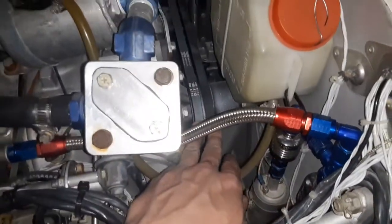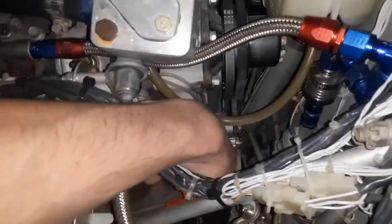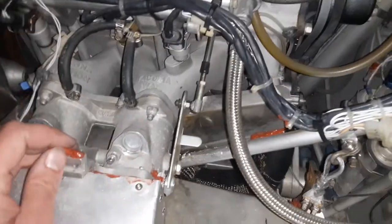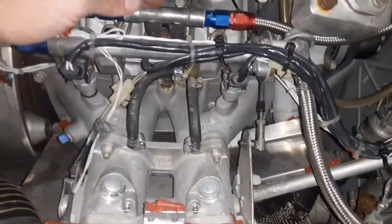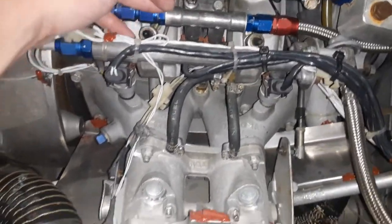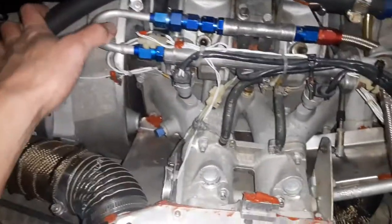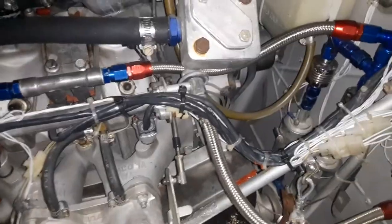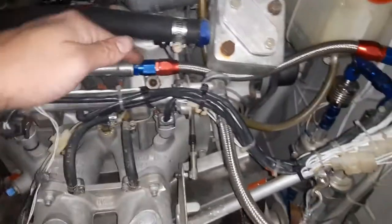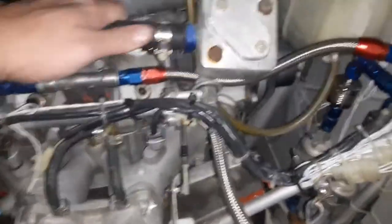There's a dual belt setup. Down here is the oil injection pump — that's disabled. Most Mazdas use engine oil that is injected into the combustion chambers for added cooling and lubrication. We use fully synthetic AMS 2050 oil. The engine and gearbox share oil. We pre-mix the AMS oil injector oil into the fuel, so you don't need the oil metering pump, and we can control based on conditions how much oil we want mixed in with the fuel.